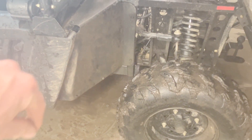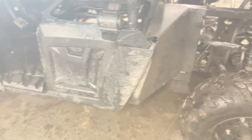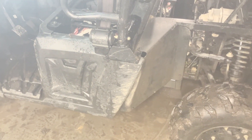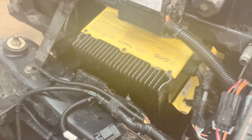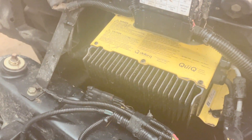Then I'm going to remove the rear inner panel, inner fender panel, and the side panel, then unbolt the battery hold downs, remove the batteries, remove the battery trays, and the bottom skid panel.